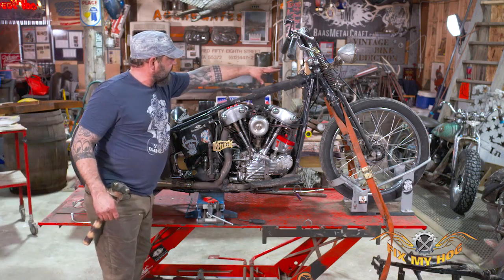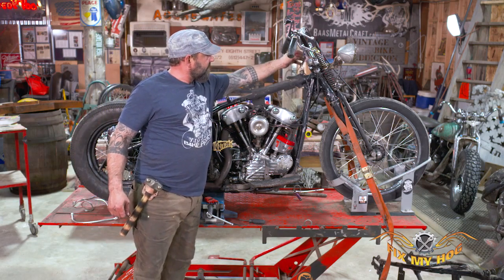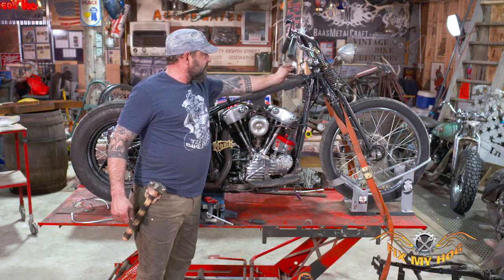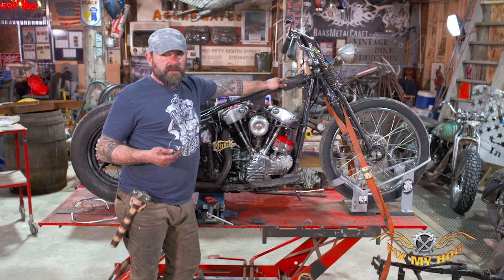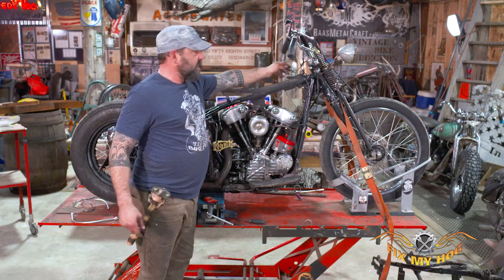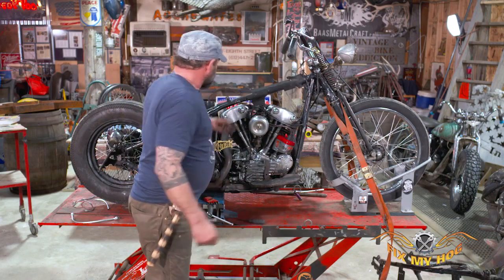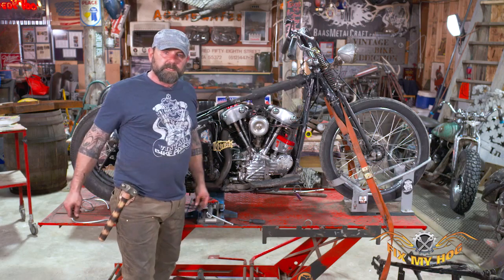Now we get a better visual of the whole top of the bike. We can see we have some wires coming through the frame that we're going to have to get at — we may have to clip some of these wires. When we start taking wires apart and doing the electrical stuff, we really want to mark everything so we know where it came from and where it goes, so when we put this back together we're not looking at a pile of wires going 'I don't know which one goes where.' Give me a minute — I'm going to get some tape and a marker and we're going to mark some wires before we disassemble.